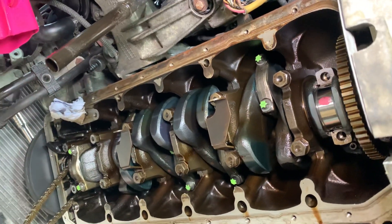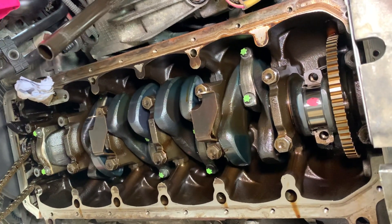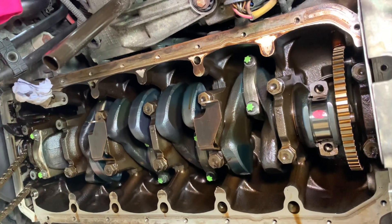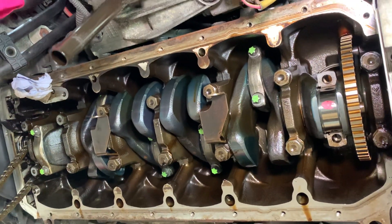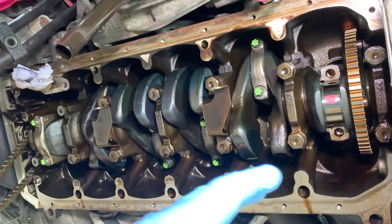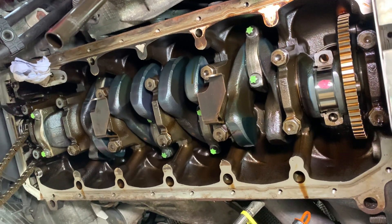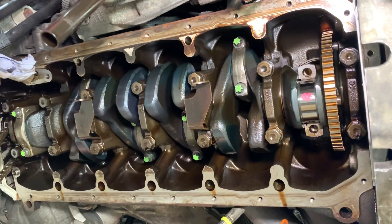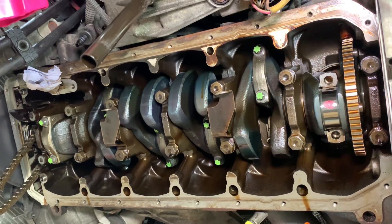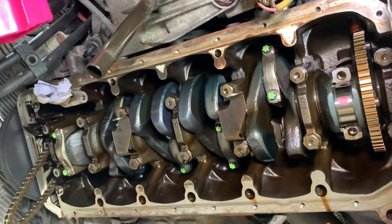That's what we come to expect when using the ACL Race bearings — more specifically this is the Reedish custom mix set where we use an H and an HX blend of bearings. We do that for two reasons: firstly, we're able to fine-tune and create an optimum oil clearance if we find an issue — for example if a car has had a replacement conrod, a polished crank, or what we call a tolerance stack engine. In your case we didn't find any problems, so we ran them in our normal process and they all worked out fine.